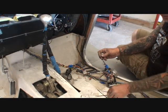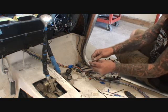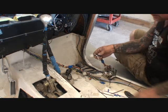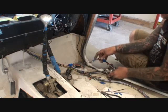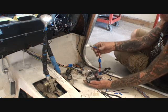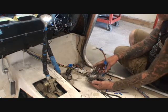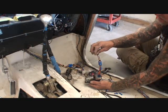We finally got done wiring everything up. I like to use wire ties - I don't like to use black tape because eventually black tape will deteriorate, come loose, and looks sloppy. Black tape is nothing but a waste of time and energy. So what we've got here: we went ahead and added our nine-pin connector. We used eight of the nine pins, so we still have one left just in case, like if the owner wants the LED lights hooked up - we can use that spare pin, then run our ground into our white wire, which is the ground wire on this system.